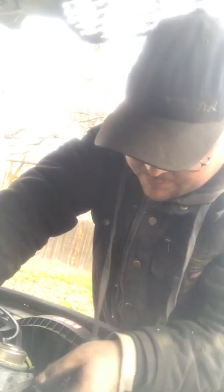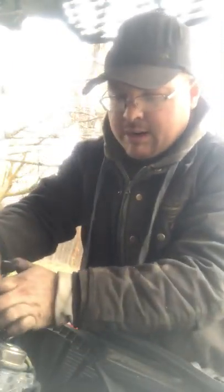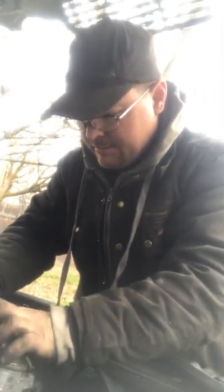Okay, so this one is out. Grab the nut, push it in, slide it down, out of the way. Now, all coil packs are off. All three are off. So I'm going to slide them out of the way so that I can get to the bolts that are holding my valve cover in place. Okay, I'm going to take my wiring over here out of the way.